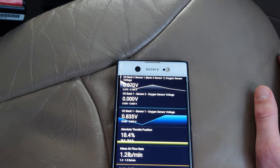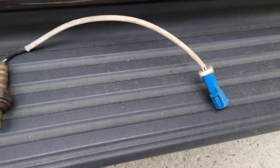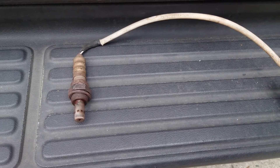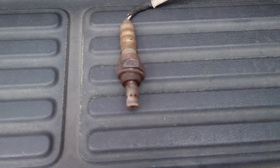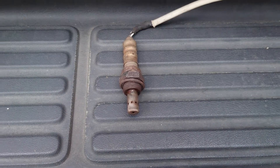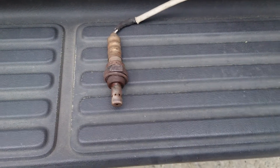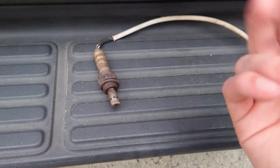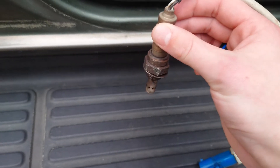I went ahead and took out the sensor, and that's right down here. It is a pain to get out - if you're going to try to take this thing out, make sure you have enough strength to do so. I barely had enough, and that was using a very large wrench I had to borrow. After 19 years of being nearly rusted onto the exhaust pipe permanently, it's a pain to get these things off. It's very simple though - you just disconnect the quick connect and unscrew it. Righty-tighty, lefty-loosey. It sits on top of the exhaust pipe.